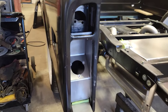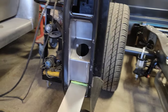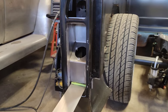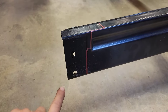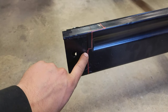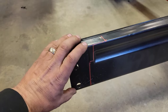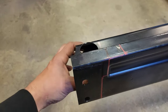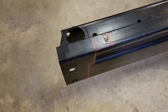I finished up all the welding. Next I'm going to mask off the hinge and prime this until I'm ready for paint and body work. I've marked on this cross member where the box panel rests and I'll cut here with a zip disk to remove this material so I have enough room to send the fuel filler hose through this cross member and then to the fuel cell. Let's start cutting.